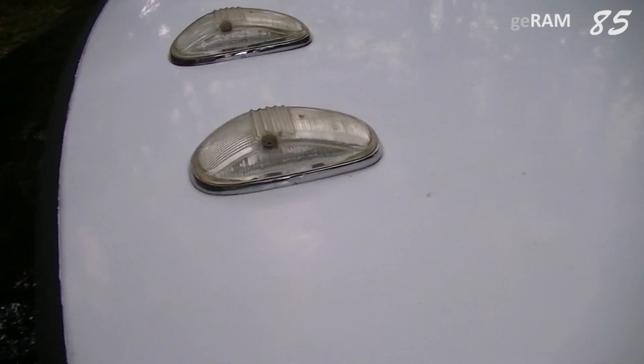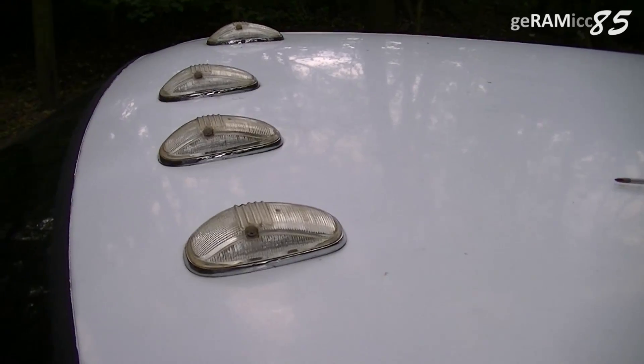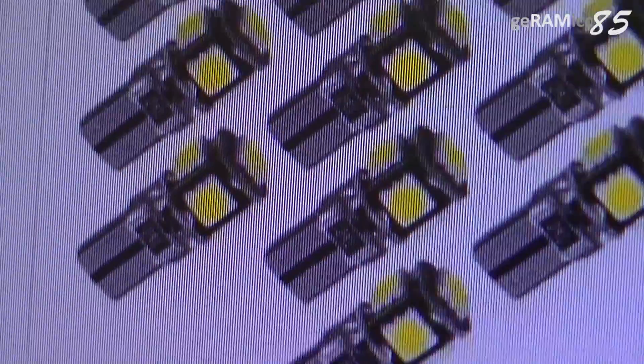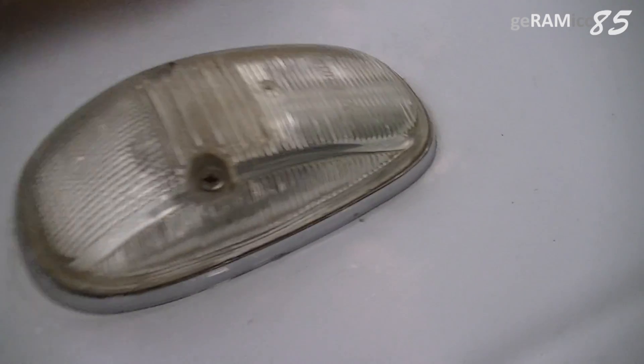Anyway, back to the LEDs. I don't want to replace them all the time. Usually car LEDs should work at 12 volts, but sometimes the alternator puts out more — like 13 or 14 volts. If you buy LEDs, make sure they can take more than just 12 volts. Good quality LEDs can have a volt range of, for example, 12 to 18 volts, and maybe won't start hyperflashing and breaking.